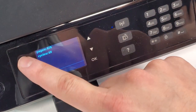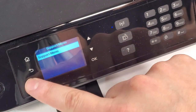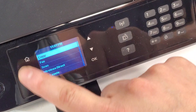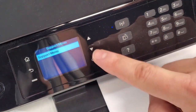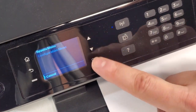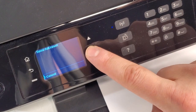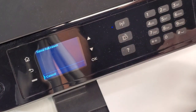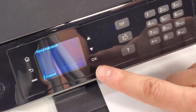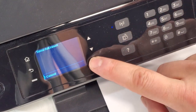I'm going to go back and show you how to reset it. We're going to cancel out and do the sequence again: dash, home, dash, dash — support menu. Press OK, then scroll down to the resets menu. There's a partial reset, just if you want to reset the region and the language. But the semi-full reset does most of the factory reset, so that's what we're going to do.